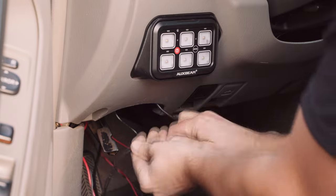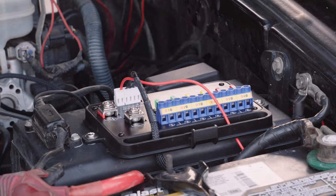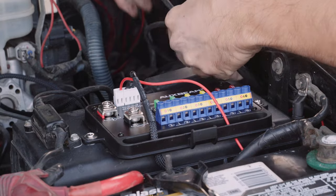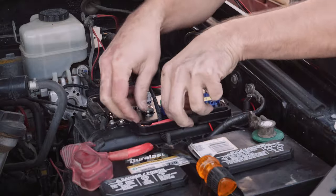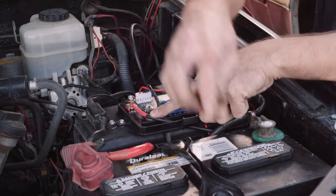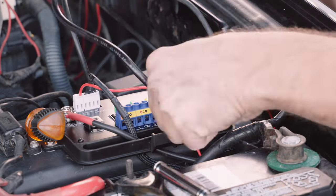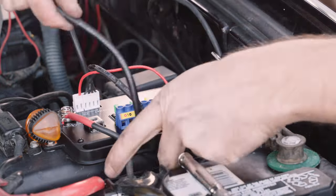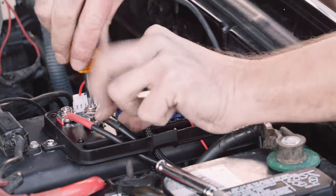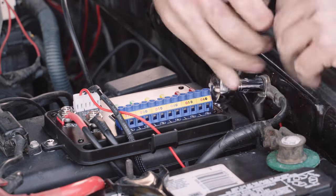I already have a fused positive wire running from my Lion Energy auxiliary battery, but this is when you would want to run a positive wire from either your starter or auxiliary battery, and be sure to fuse it or run it through the included breaker. Then run your negative cable from the battery, chassis, or body to your fuse box. Bad grounds can cause many electrical issues, so be sure your source battery has a solid body and chassis ground. Link below to the crimp connectors, heat shrink, and tools I used.